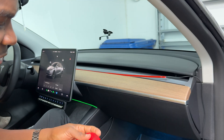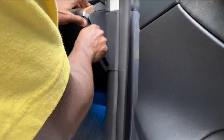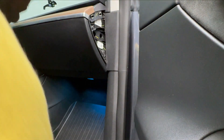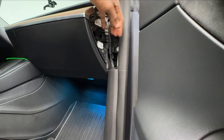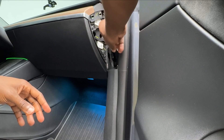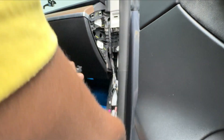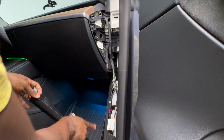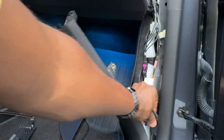We're working with the space in here. This is very easy — take a pry tool and push it in here to pop up that spot. There we go, that piece is out. Same thing here — pull it out and up. In the Juniper Model Y, this whole piece is one single piece, so those two pieces come out together. There's a little clip in here that you're going to pop out, and then once you pop that out, this piece simply comes out.